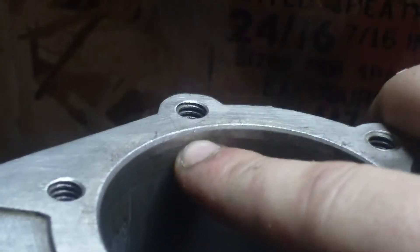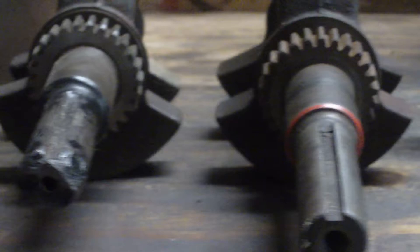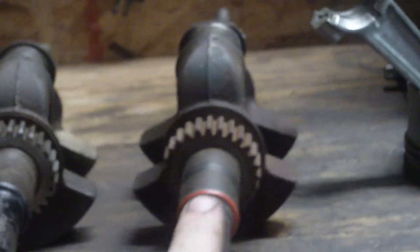If you look, the two crankshafts are different — this one's a little bit shorter and this one has a little bit longer stroke. The piston will come up to about the top of my fingernail at top dead center, whereas with the other crank you have to bring it up level with the deck. So I might be getting some more compression and maybe a little more power out of doing that. That's what makes me think this might be a three and a half block, because this crankshaft I know came out of a five horse.